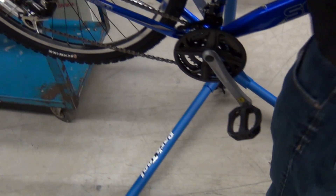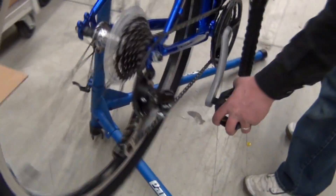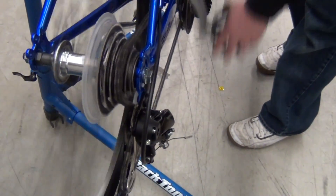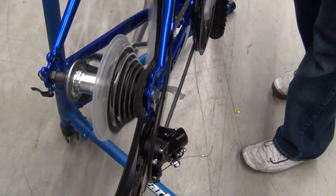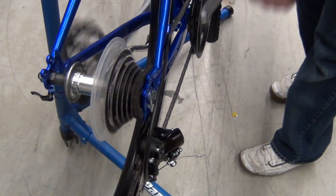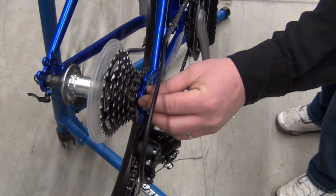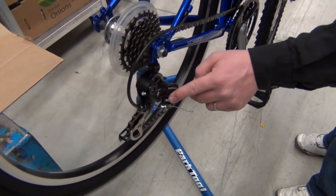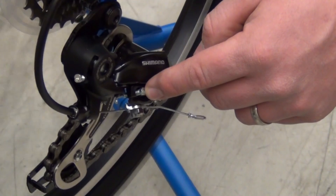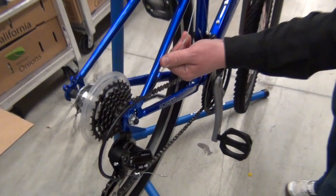I can now move my attention to the rear gears and check the same thing - see how it cycles. I clicked through six times, which puts me up into the top gear, and I can drop it all the way down. I have full range of motion. We'll go into finer detail about how to adjust the limits all the way on the outside and inside - that's what these set screws are for, they're really just limit screws. We'll also go into more detail about what the cable tension does to fine tune this.